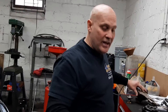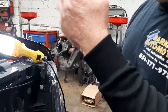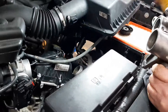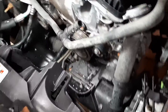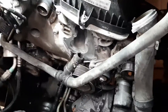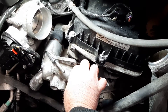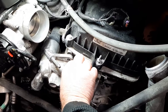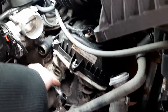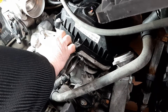The reason why I'm doing the video is because you've got to be really careful. This right here was all caked in — I got it all cleaned up, ready to go back in. It is steel, so we lucked out; usually they try to do this with plastic. This piece right here slides into here, generally right about like that. You've got to take this off to get to the water pump, which is down here. This is the water pump housing — the thermostat housing goes over top of it.